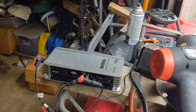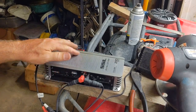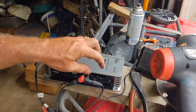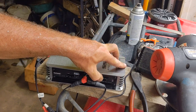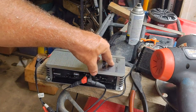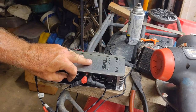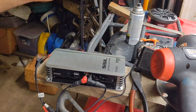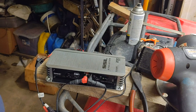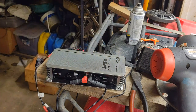On this Soundstorm amp, it's tough to adjust settings once it's installed. I put it on full range — your only options are low pass and full range — because these speakers aren't subs and they have a tweeter in them too, so you want full range. I go ahead and turn the level all the way up. These speakers are about 300-watt max and the amp doesn't actually put out its rated 200 watts, so you're not going to hurt them. You control volume with your phone anyway.